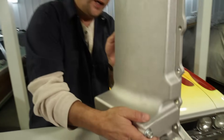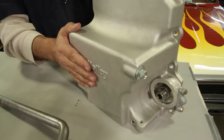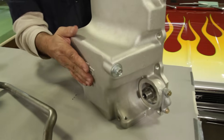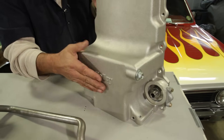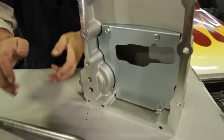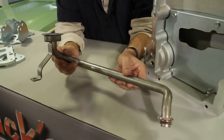One of the most critical parts to make this swap a success is the oil pan, and Holley has made just what you need right here. This is a heavy-duty cast aluminum oil pan that's going to bolt right up on the LS engine. It's got a shortened sump that's going to allow you to clear most cross members. This thing will fit from 55 to 87 GM chassis, most of them. It also still retains a five-and-a-half quart capacity, six quarts with the oil filter, and this thing even comes with its own built-in oil filter adapter. Holley has even included their own special pickup for this oil pan.